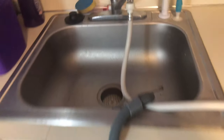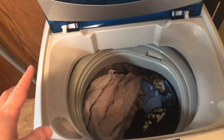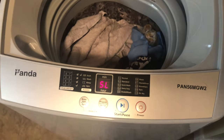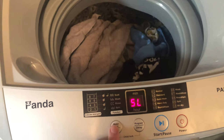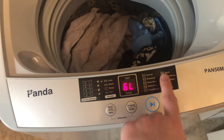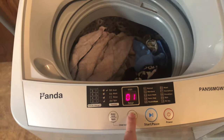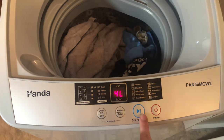To turn it on, make sure you turn on the water first and leave the water on the whole time, because during the rinse cycle it keeps adding and draining water a few times. Turn it on, then set the water level — I'm going to put it up to six. To choose the wash setting, just keep pushing this button. I'm going to do a quick wash, and then push start.